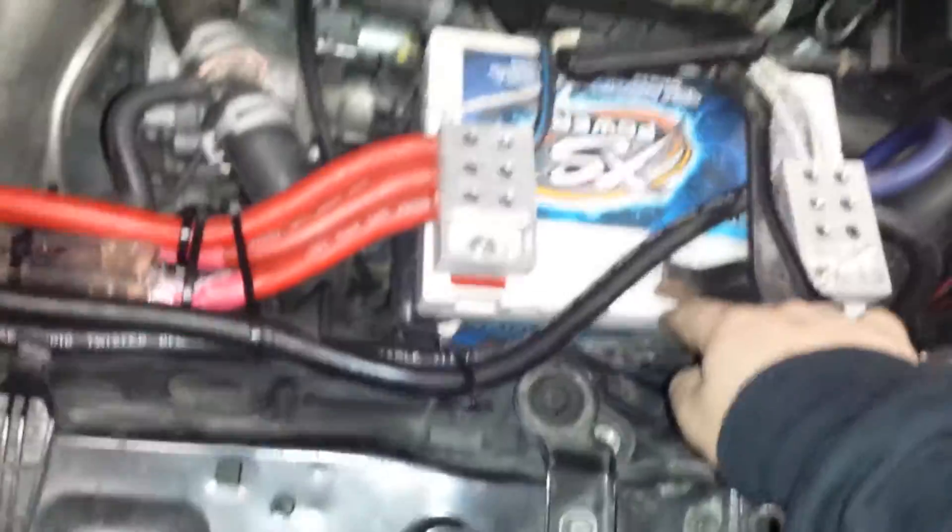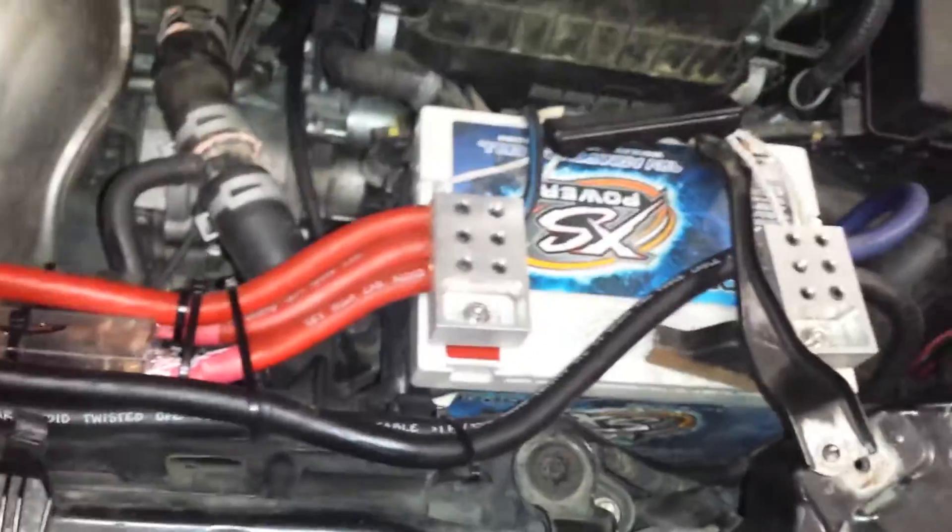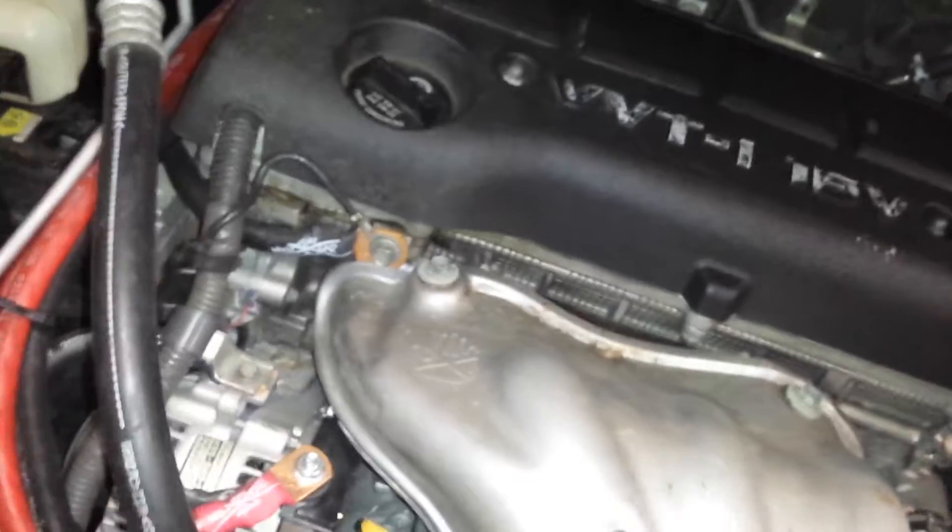And it's that simple. That's your big three. This wire is going to the back, and so is this one. A really good ground is the engine mount, so that's that. I hope this helps with your big three, and have a good night.